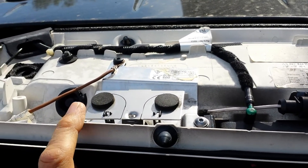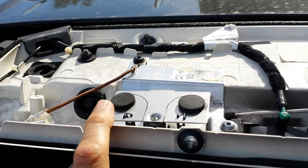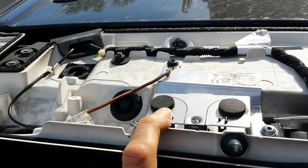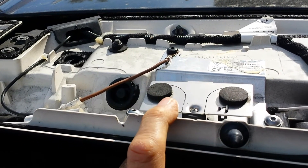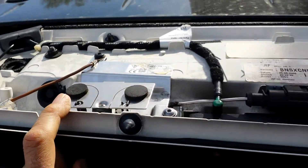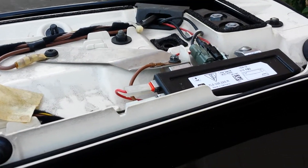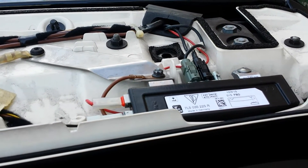So if you hook up another antenna, make sure you lay it down in a horizontal position and then do your test. If it is still doing the same thing, then you know the problem is the amplifier, not the antenna. In most cases, this amplifier is what goes bad.